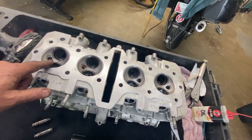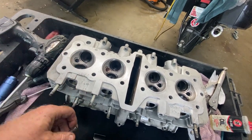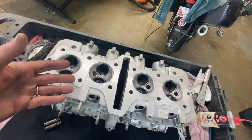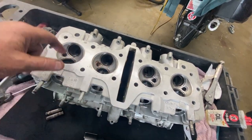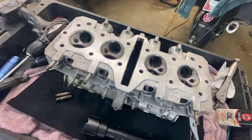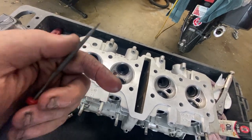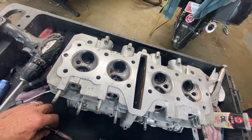I did the intakes first because one of the problems with the exhaust is that it gets a carbon buildup around it — you don't really want to drag that through the hole since they come out from this end, and what bottoms them out is those little clips around them. The intakes cleaned up really well with a round brush in a drill to clean out the ports — pretty much spotless, no carbon. I did the same thing on the exhaust side and it took out about 95% of all the carbon, then I went through with a needle file very carefully around the valve guide, like cleaning teeth, and picked out the remaining small bits.